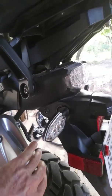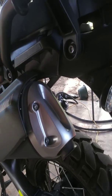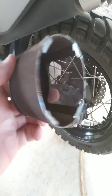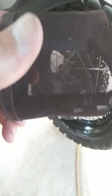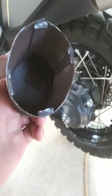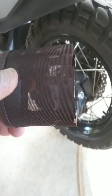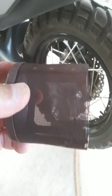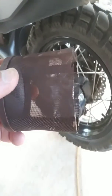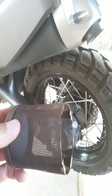Okay, and you'll see here's your tube is actually bent through that plate, and then on the inside I found that it had this gauze, which I would imagine is a spark arrestor, if anything. It seems like titanium wire or something, because it was quite tough to grind through. And importantly, either 304 stainless or 316 stainless or whatever, it didn't make any sparks when I was grinding it. But I decided to mod my exhaust myself to give it a bit more throat.